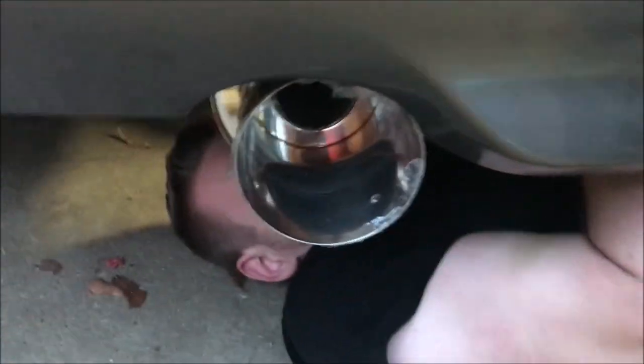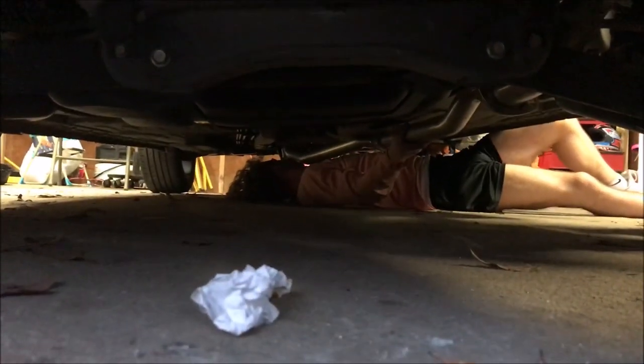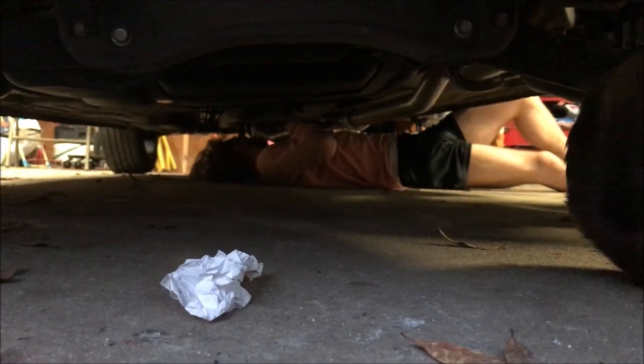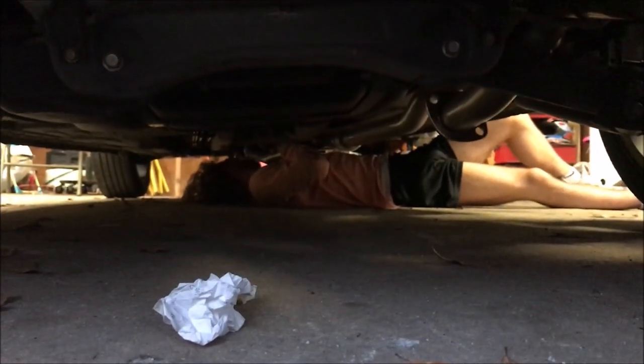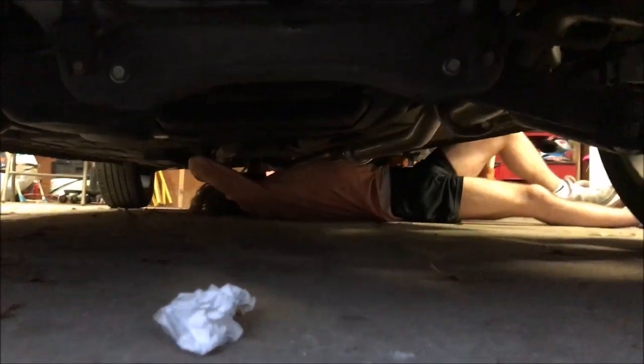This is the muffler. I thought mine stuck out further, and this fitment is definitely not perfect yet because we have not put it all the way on. It's still not going on. Brock's trying to get it on. He said it's not letting them get the flange onto the studs because the heat shield on the cat is too thick. And yeah, see, this is definitely not on the way because the flange right there isn't even connected.